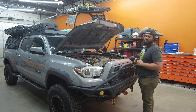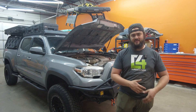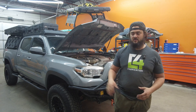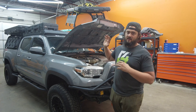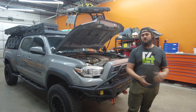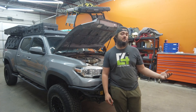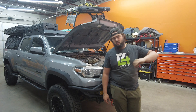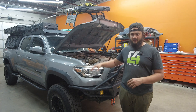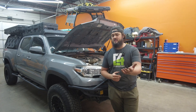Before we go any further, one of the most popular conversations we have — that's really hard to have over YouTube and social media — is about what you need your vehicle for. This guy and his fiancée love spending multiple days in the woods but have to work remotely, so they use Starlink. That's why we're doing the lithium secondary battery, because Starlink draws so much power you really need it. That's also why we're doing the BCDC 1250D — the 50-amp charge unit — because they need to take advantage of their limited driving time to charge that battery.